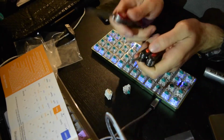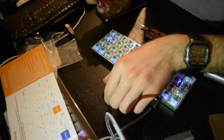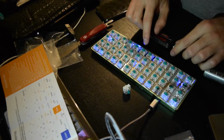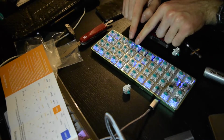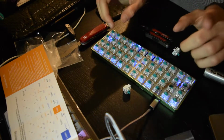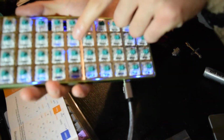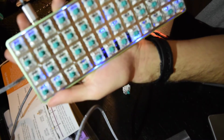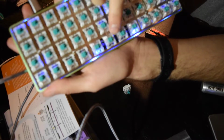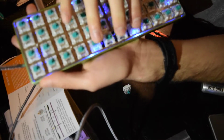You might see that I have my knife out and my 2 little bottle openers up. And I want to show you what I ran into. Massdrop doesn't really tell you how you're going to orient your little keys right here. They say how to orient them if you're going to use a 2U shift key right there. But I want to do a full bar build. So what I ended up doing is I do it like this. These are all facing the correct way, and then down on the bottom, all of these are upside down. So if you're gonna build yours and you want the bar configuration, just put them in upside down.